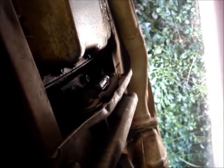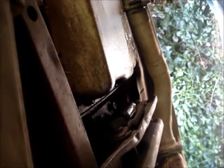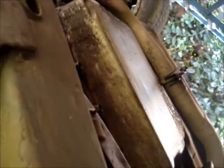That way you can just break the seal of the gasket and you don't drop the pan and end up with oil all over your face. I would clean it off first, but I'm going to clean it afterwards because I don't really feel like laying around in water while trying to fix this up. So yeah, we'll start off with the fluid and gasket and then do the lines up front.